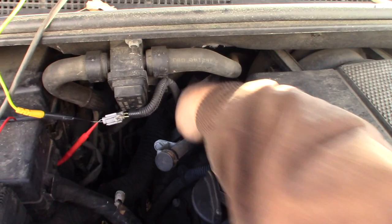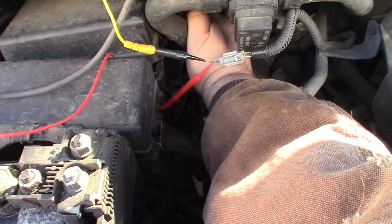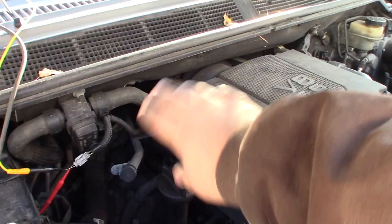Now this one here to the heater core, I think we can get to okay. Yeah, we can get to that hose clamp just fine and pull that off. But this one we're gonna have to just splice it right here. That's a perfectly acceptable repair. Rather than going clear back in there, it's gonna save them a lot of time. Because to get back into that, I'm looking at a couple hours labor. This right now, I'm into it for an hour, so.